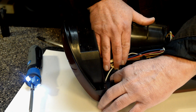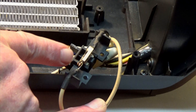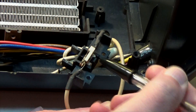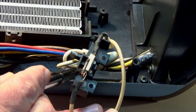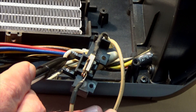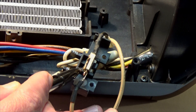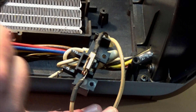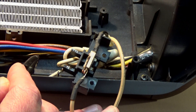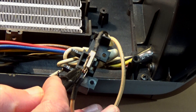Underneath that it just pulls off this way. It's a piece of metal like a spring and then a contact. And if you take like a pen, you can move it away like that. These are normally closed in normal operation. But if this thing gets too hot, this metal up here expands and it pulls it away from the other contact — it breaks your power connection and the heater doesn't run. So if this thing got plugged up really bad with hair or something, this thing might have just sprung out, which would indicate a fault. But once you get this air situation taken care of, this should spring back closed.